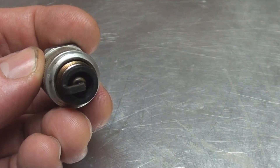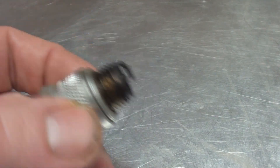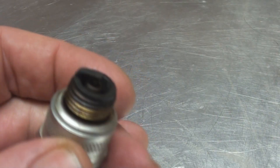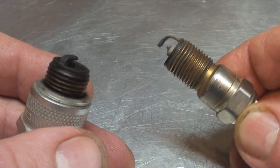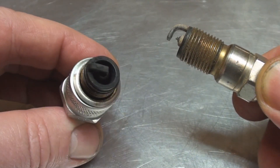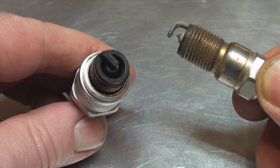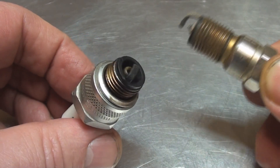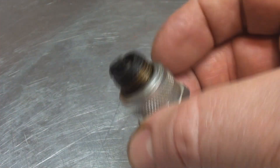The spark plug is a little bit blackened — fouled, you would say — and the most likely cause is over-fueling, a rich fuel condition. Comparing it to a spark plug out of my car, which is a very clean burning machine, especially alongside my lawnmower. However, a machine like a lawnmower sees quite dirty service and has a crude air filtration system.